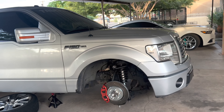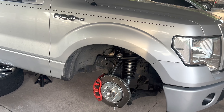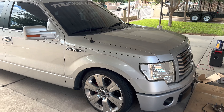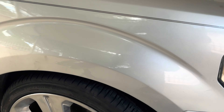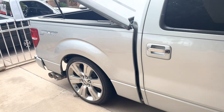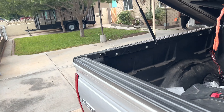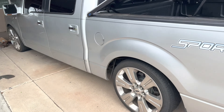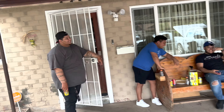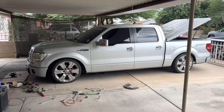One thing is I had adjusted the upper control arms to half an inch based on what CTP told me, but I think I'm gonna adjust a little bit less because the wheel was pushed out a lot. I'll redo that adjustment now and then get started on the other side. Finally, we finished — it's like a three-finger gap all around. To be honest I should have gone lower. That's your boy Luis, Jose, and Randy — but that's how she sits.